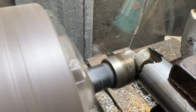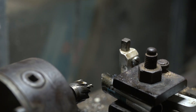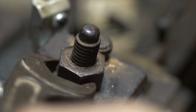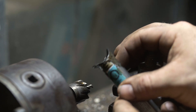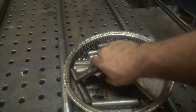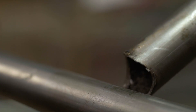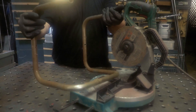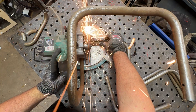I repeated this procedure 16 times with all the tubes and ended up with all the parts I need. Welds will be much easier made this way, as I'm shaping the parts so they fit much better. I removed the big bolt that was holding the tube in place and can now see the cut result. In one and a half hours I cut 16 tubes on both sides and they look amazing — the fit is very precise, which helps me weld the parts better.